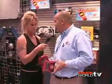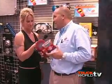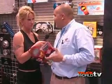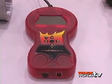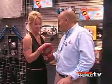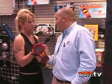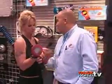Another new product we have this year is that we've branched out into the flash tool business. A flash tool simply plugs in under your dashboard into your diagnostic port and allows you to enhance performance by changing fuel and timing curves. We offer the Fuego, which is our Ford tool. One part number fits all — it works on any Ford Explorer, Ranger, Excursion, and handles both gas and diesel applications, from an economy car like the Focus all the way up to a big V10 or even a diesel Power Stroke.